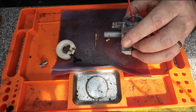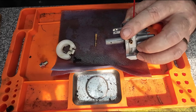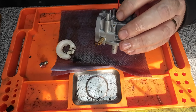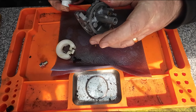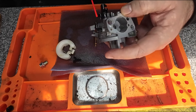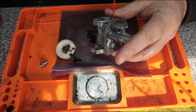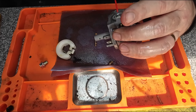All I'm going to do is literally poke my straw in and clean every single orifice I can. You'll see as I'm cleaning it, it's coming out of different holes. I'll block this hole up and run it through — go down through this hole down here through the centre, and that will come out down the bottom. Anywhere where there's a hole, put this in and try to get fluid to come out of all the orifices. Just be very, very thorough in everything that you do — you're looking for any signs of dirt that may affect the running of this carburettor.